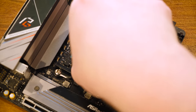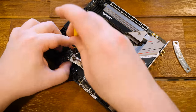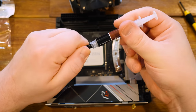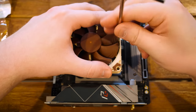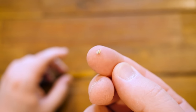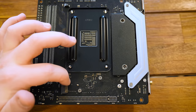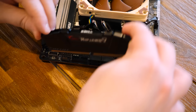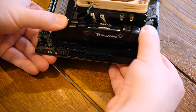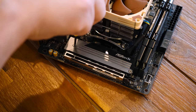Going ahead and dropping the Ryzen 5 processor in place, getting the default AM4 mounting hardware removed since our Noctua setup has its own mounting plates. With those screwed in, applying NT-H1 thermal paste to the CPU and dropping the cooler assembly on top, screwing it in neatly. While working, I noticed tiny LEDs on the underside of the motherboard had been knocked off — ridiculously tiny and not worth reattaching. RAM pops in with a satisfying click, and the NVMe SSD slides in under the motherboard heatsink.